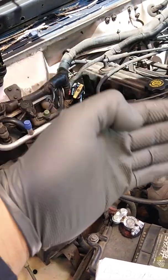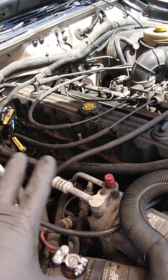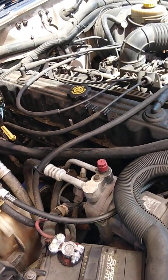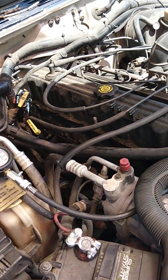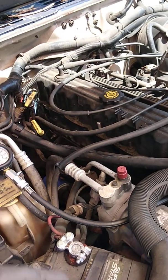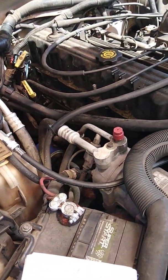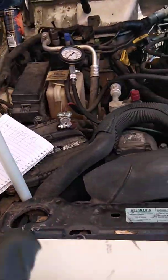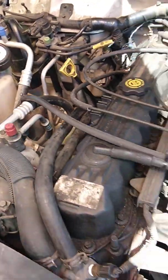I don't know much about this vehicle — they bought it used, it was wrecked in the front a little bit. I've done some basic maintenance on it: water pump flushes and so on. But now it's having this misfire problem, so I said I'm going to check the compression on the cylinders to get more information on what's going on. This vehicle has about close to 300,000 miles on it, so it's been used and abused. Anything with that many miles through different owners is eventually going to have problems. I'll write my information down and show you what comes up on the compression tester on this first cylinder.